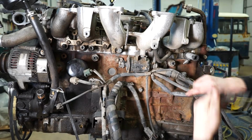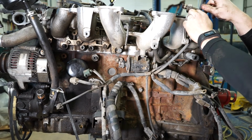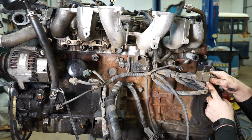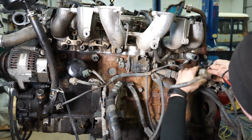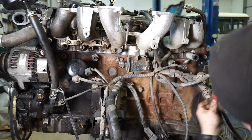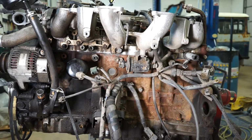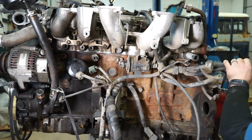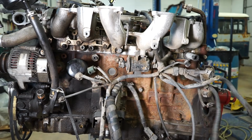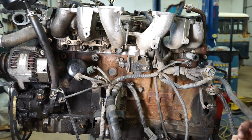And then this wire was the one that went up here to the, oh, I'm going brain dead. The temp sensor for the EGR. So then up above your starter, you'll have these 2 big bundles of wire, and these are your transmission harness. And then you'll have 2 long wires that snake over the top of the transmission. And one of them will have a big harness. This goes to the park neutral safety switch on the side of the trans.